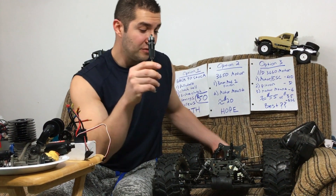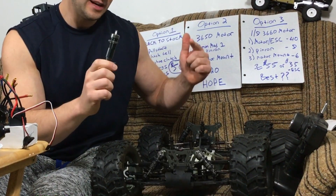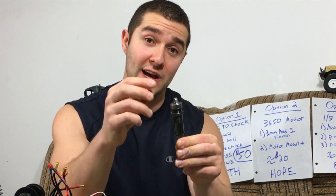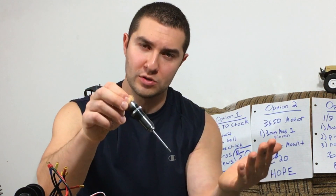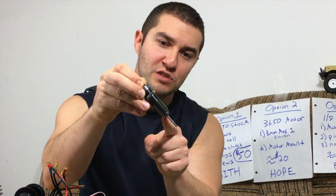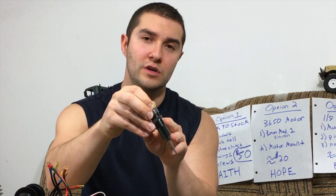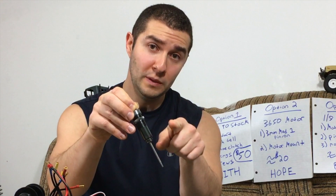In regards to the shocks, I've rebuilt two already — check out this damping action in the front. It's really good, the shocks are good. I left one un-rebuilt for you. I just added a little bit of shock oil because I ran out of shock oil. These shocks are so huge — they're big bore racing shocks — that I had to order more shock oil, which was like eight bucks. But look at this rebound as I press in the shaft. Look at how nice and even and smooth that is through the stroke — that's really nice. That's what you want to see. I have a little bit of a thicker oil in here right now — I ordered a little bit of a lower weight. So right now this is 80 weight. I ordered 60 weight. I think 60 for this would be perfect.